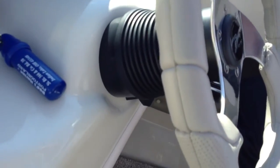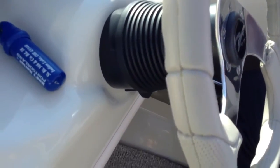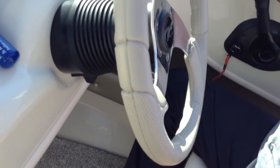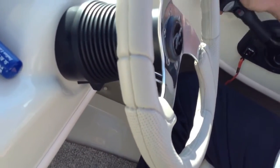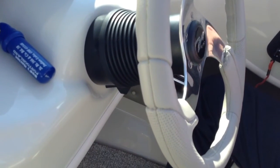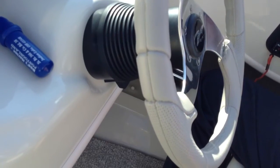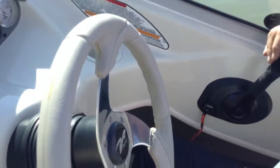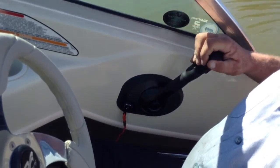When I push the handle down and put it in throttle, this is throttle only. This button will pop out, and then you push this button again — that puts it in gear. Back to neutral, then reverse is the same.